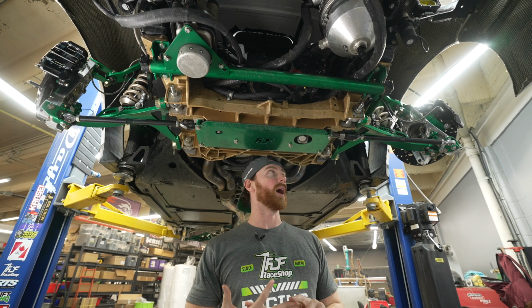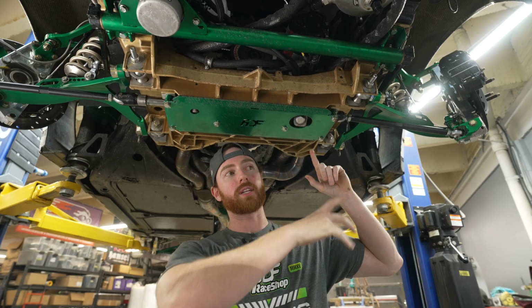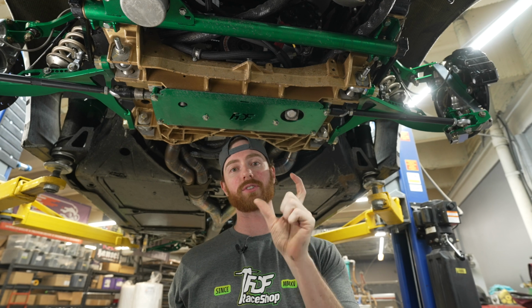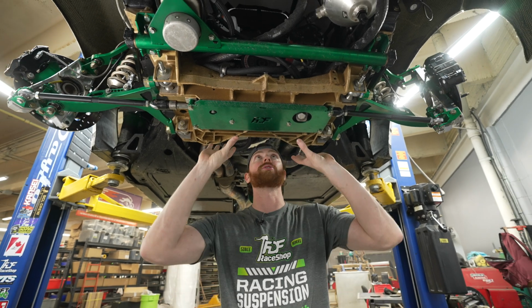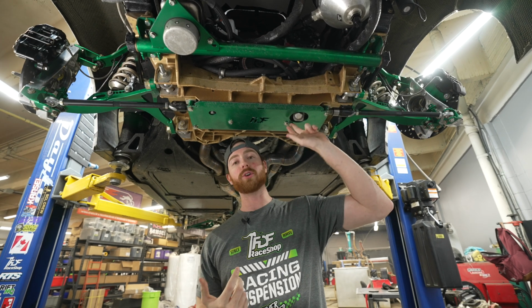Essentially, buy an E46 steering rack. The kit will come with the steering shaft adapter, which connects the factory steering column to the BMW rack with no other modifications. Just a little piece that we machine here, and everything bolts right up. Any E46 steering rack will bolt to this plate. I know there's different versions, purple, gray, yellow. We're using the gray plate.